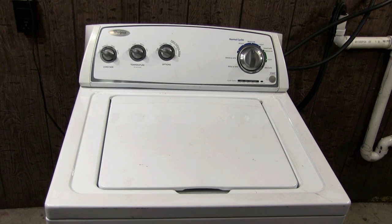In this video I'm going to show you how to put the Whirlpool vertical modular washer on the tachometer verification mode. The tachometer verification mode is used to see if the shifter is working okay or not.